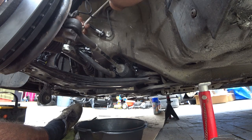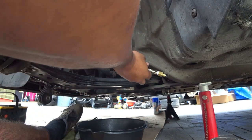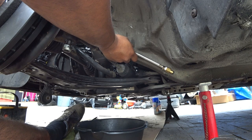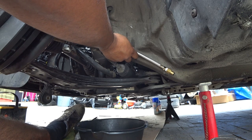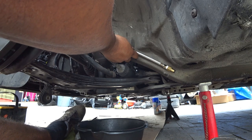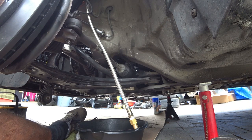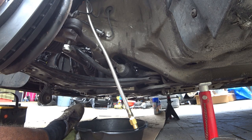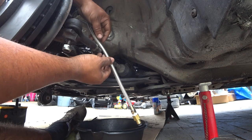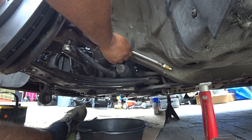Right now what's bothering me is this right here — I don't want it touching anything. I want to prevent this line from touching as much stuff as possible. I want to turn the bag a little bit more to the left so it centers itself. I call it the hard part because you've got to make sure things are sitting correctly. If not, this will rub and rub — it'll take a long time but it'll rub enough to wear through the hose and make a leak, and then all sorts of bad stuff will happen.